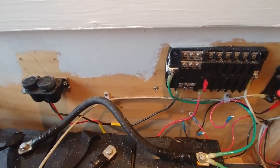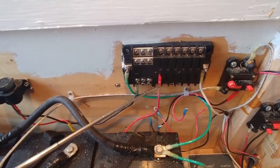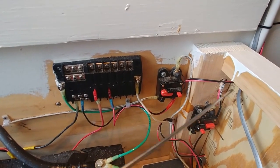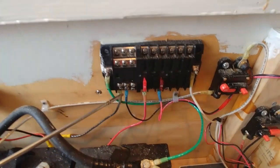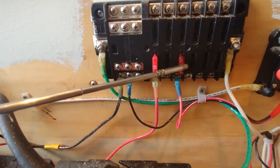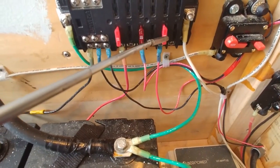I've wired in the 12 volt cigarette lighter — taking the red and black wires, the black wire attaches to the ground side, and the red wire attaches to one of the positive sides with a 10 amp fuse. You just screw it right in and put in a 10 amp fuse. The red and black wire from the ceiling fan loops around behind the breaker — the black wire to ground and the red wire to a separate 10 amp fuse to protect that circuit, as dictated by the max air fan manufacturer. The red and black wires from the sink pump also come up and loop around, with the red wire attached to the fuse block protected by another 10 amp fuse.